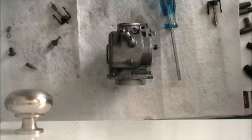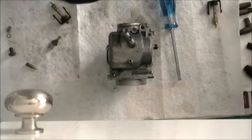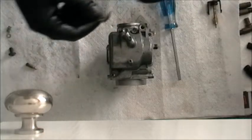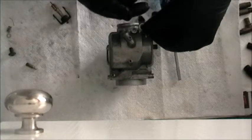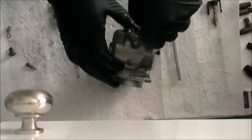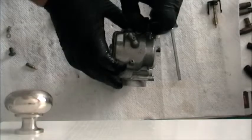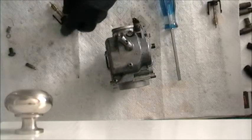Well, for the sake of the video, assume that we put both screws in there, because I will go find that, but I just wanted to show you guys something special. So this carburetor has this little tab that goes on the heater and provides a ground for all the other carbs, and it just kind of sits on there like so, and then you screw in the heater, same as the other guys. Just like this. Get that a little crank down.